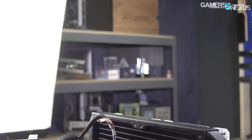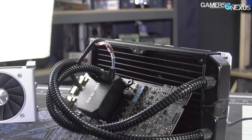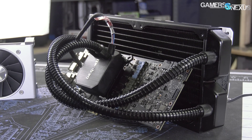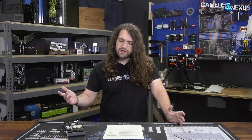Testing today, the primary focus is going to be on thermal performance versus frequency performance, so we're using 3DMark and FurMark for that. We also have some game benchmarks to see if lifting the thermal limitation gives us any additional boosting headroom that actually benefits us in games. Typically the answer is it's worth doing, because typically we get anywhere from 5% to even upwards of 9% in a couple of our past tests with either Vega or the Pascal series cards — but it's a lot different these days because we're power limited to about 15 amps down the PCIe cables.